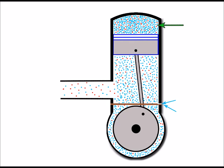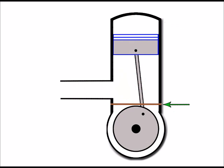We'd get the same problem, by the way, if the bolts were loose that held the crankcase to the barrel. Admittedly, there is a lot more work involved in replacing these gaskets. So before you go stripping the engine right down, it's best to be sure that it is this gasket. But if you've gone through all the steps we've mentioned beforehand, then it could well be a barrel gasket. But of course, if there's one thing I've learnt through all my years of repairing engines, it's that they'll always throw something new in for you to try and resolve, something you've never come across before. So this is more of a guide.